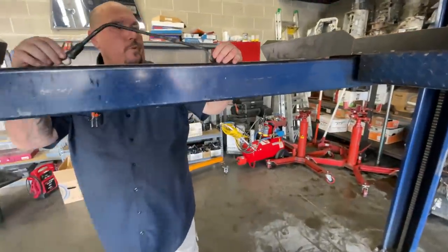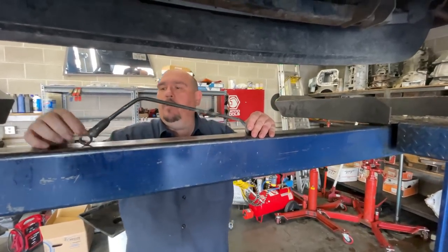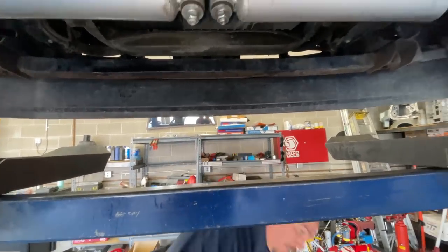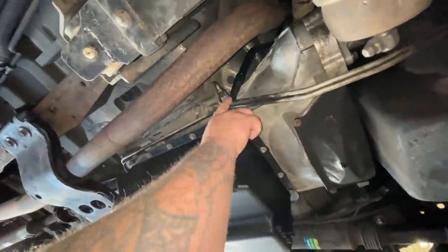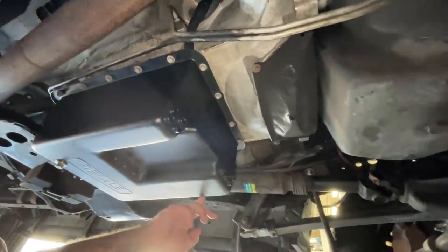Next day, picking up the truck. I'm under the truck and the mechanic is telling me about some of the things he did. This is a cooler bypass — what Ford came up with. The idea was that if the cooler gets plugged up, this ball will compress — there's a spring and a ball in here — and it'll bypass the cooler. In my opinion that's a bad idea. If you've got enough contaminants to plug up the cooler, you've got bigger problems. So what we do is machine these aluminum spacers to bypass that, so the oil has to flow through the cooler no matter what. Plus you've got airflow through fans as a backup. This pan is metal rather than cast, so if you do whack it, it'll just bend rather than crack.